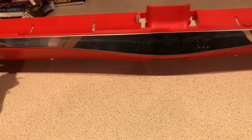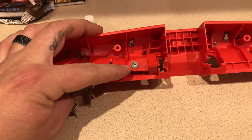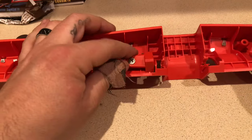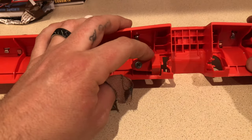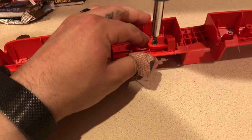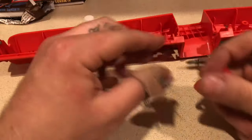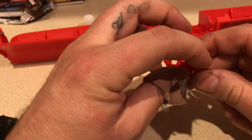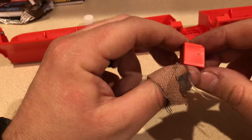Here is the water wall bar, and this guy is most likely the culprit in this situation. There could be some more complicated things involved — it's kind of a case-by-case situation — but I would definitely start here. It's pretty easy to remove; basically just take this screw out and this guy pops out. You can't buy this on its own and it's basically epoxied inside.